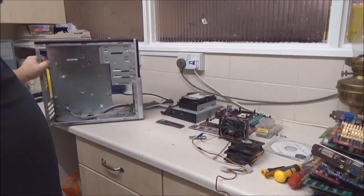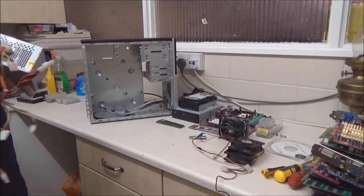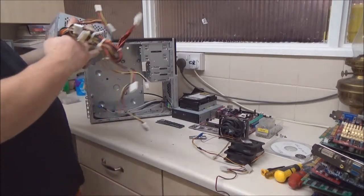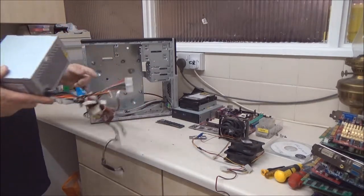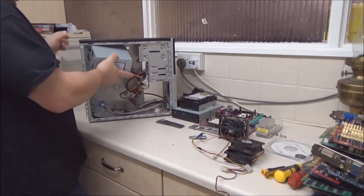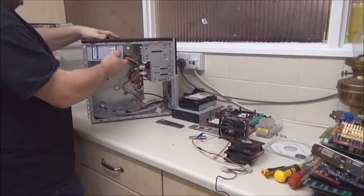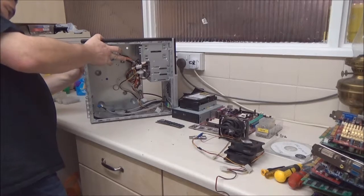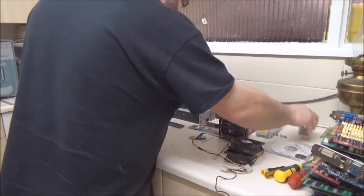What I'm going to start off with is the power supply. This is an Eagle brand — you can pick whatever brand you want. The reason I'm going to start with this is because it saves trying to jimmy it in there above the motherboard without damaging it, so start top and work down. They usually go in with the sticker facing you — that's usually their orientation. With that said, all four screws should roughly line up.